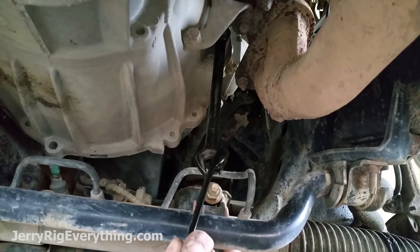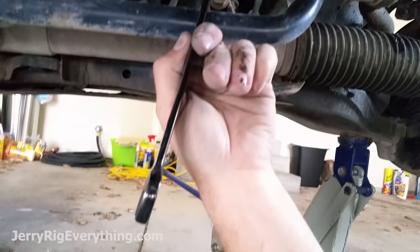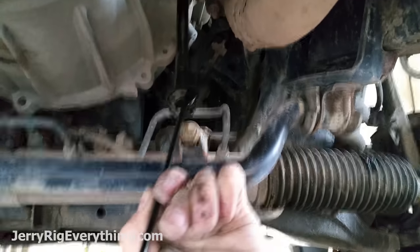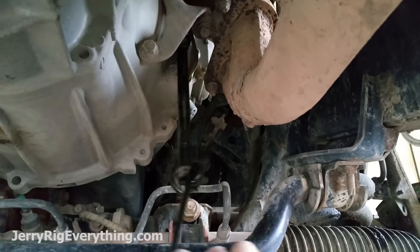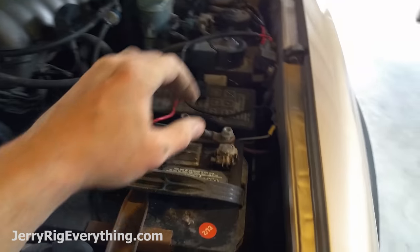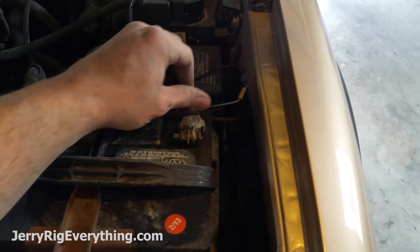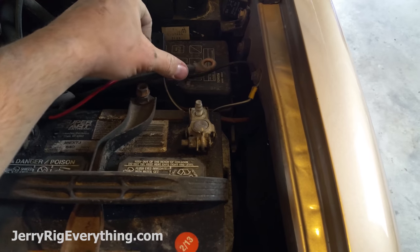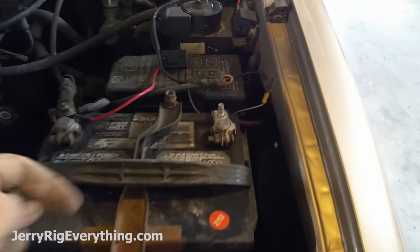To get a little more leverage with your wrenches, you can see it's up there attached to the bolt and I have two wrenches hooked together. I can move them like this — it gives me an extra foot of leverage on that bolt so I can break it loose. Before I get too crazy disconnecting things on the starter, I'm going to go ahead and remove the negative battery terminal so it doesn't start sparking when I'm working below it.